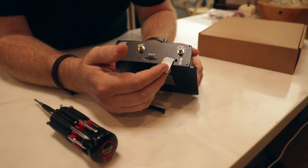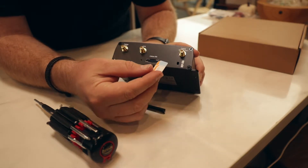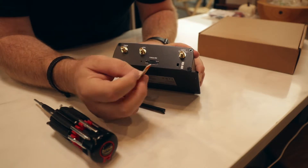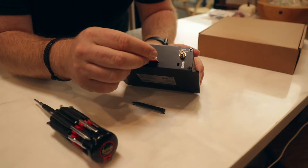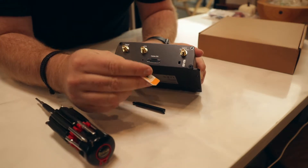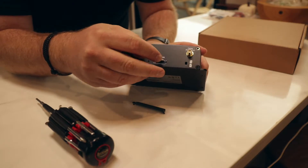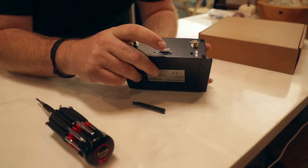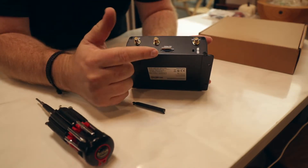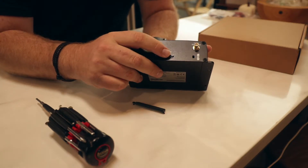Make sure the SIM is oriented the same way as the pictures on the bottom of the unit. Slot B is on one side, slot A on the other. The metal pieces on one side of the SIM always need to face the other slots — so the top slot is metal down, bottom slot is metal up. When you push these in they should fit pretty snug but you shouldn't have to force it. If you're forcing it, you might have it oriented the wrong way, so double-check your orientation.